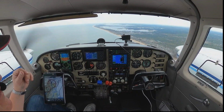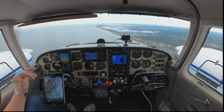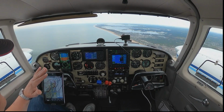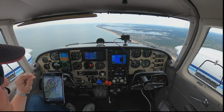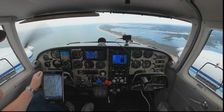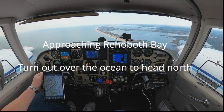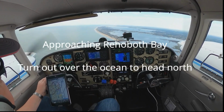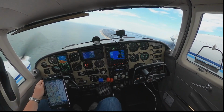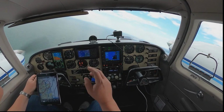Number one comm had some static a couple flights ago. That's gone away. Don't be in a rush, particularly when the airplane's been sitting, don't be in a rush to get everything fixed. Let it settle out. Sometimes the gremlins are just moisture or corrosion that's worked their way off. Okay, let's make a turn. Fly out over the ocean just a little bit.